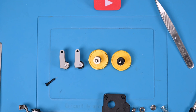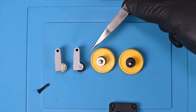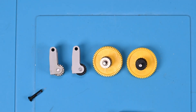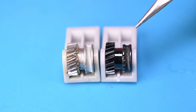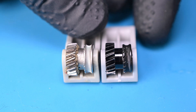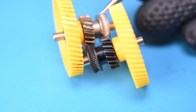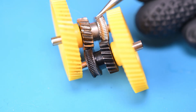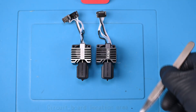I've lined up the old and new parts for comparison. Visually the only difference you may notice is that the hardened steel gears are black compared to the stainless steel appearance of the original parts. On closer inspection you'll notice the old gears have some grease on them — you'll want to add a drop of lubricant to your new gears as well. This is the same grease that's included with your printer, not the thermal one though. While my old gear doesn't appear worn, it would certainly look a lot different after a roll or two of abrasive filaments. The hardened steel however won't degrade or wear, at least not nearly as much.